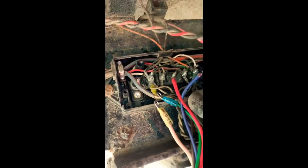Okay, so here's my taillights. Taillights, clearance lights, and then to check my ground with a test light, I'm just going to take the ground cable end of the test light and put it on this far side over here. This is your ground. That just confirms I have a ground here from the white wire. Brown wire is your taillights and clearance lights. White is your ground. And then you can go through and there's a truck diagram.